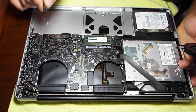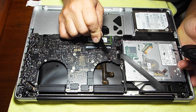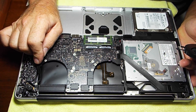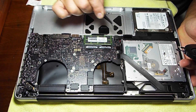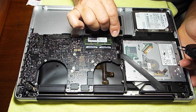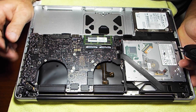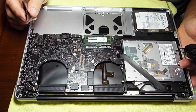We've got the board basically back in. One little note: this connection has a little lever on this edge that you have to lift up — it makes the ribbon connections go in a lot easier, and that's the one we missed going out. It hooks right down to this board. Don't forget the connection on the underside over here. You've got eight connections total — most of them go down, except for one you push in. Everything should click together with very little pressure from your hands. If you find yourself manhandling something, you might not be where you ought to be.